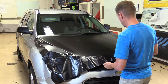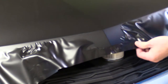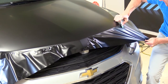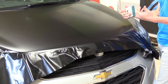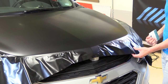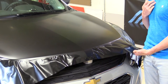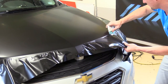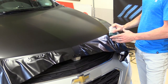Now we're going to get to the hard part — wrapping the curve. I like to do everything from the center out, so I'll start here at the center edge and come over to the center of this corner with a big stretch. When you have a big curve geometrically, a flat square foot distorts over a curved surface area, and the stretch is how you accommodate for that. This is where a high-quality vinyl comes in real handy — a thin cheap vinyl would just tear.